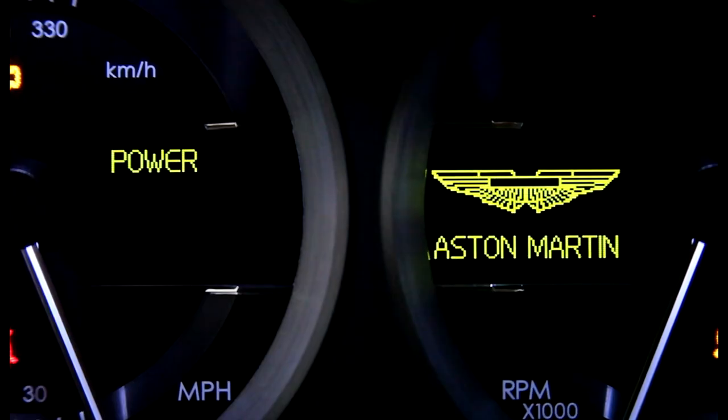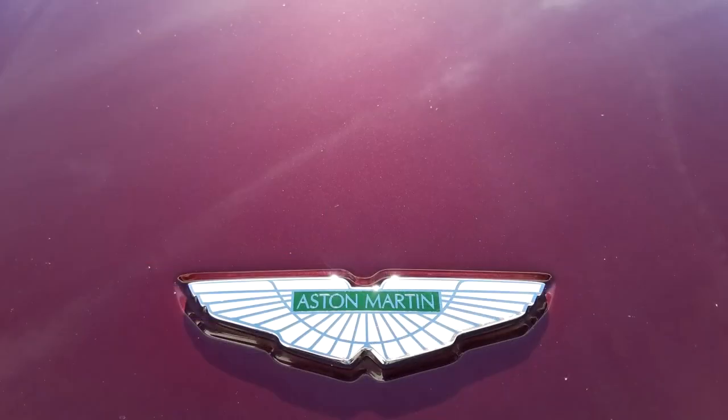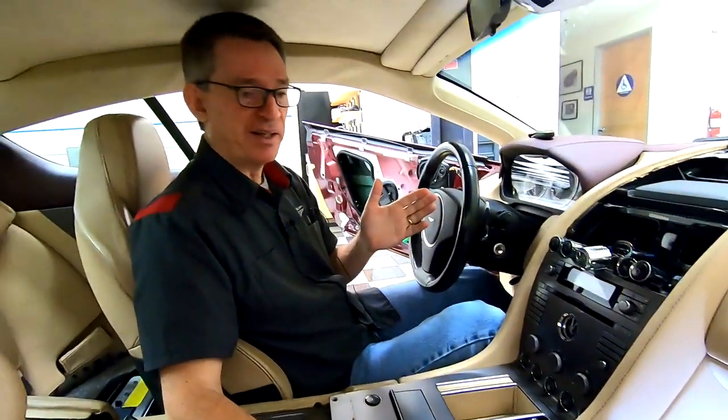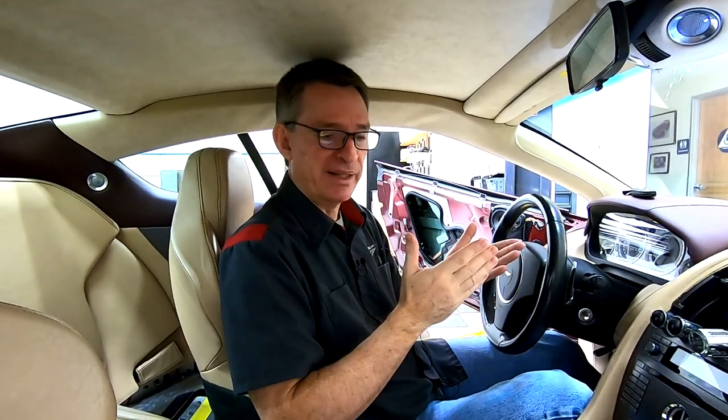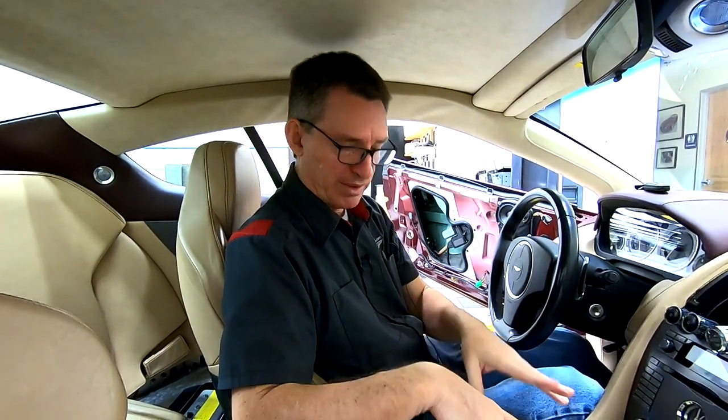Let's test that this thing actually works. In this episode of Aston1936.com, we're inside the car. I'm in the middle of my Aston Installations HD infotainment upgrade. As you saw, I have a complete mess of spaghetti rough-connected down in the footwell. All the components are installed — the new HD screen, the microphone, all the special buttons, all the wiring tied together, and the front and rear parking cameras are connected. I want to do a dry run and make sure all the electronics work.